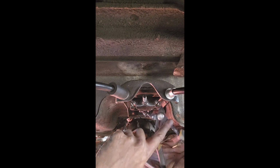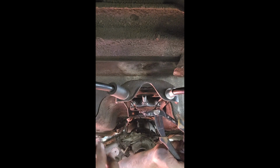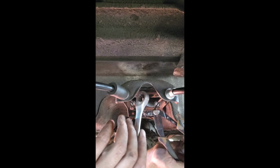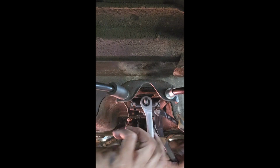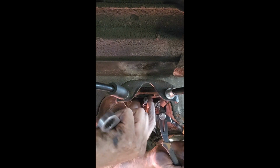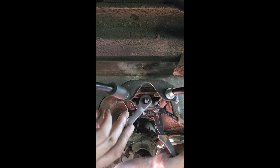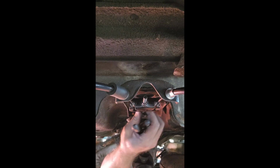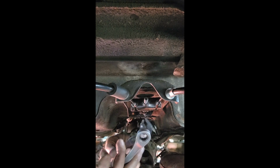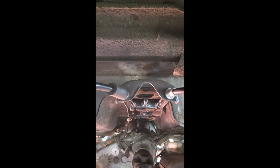Back it off a little bit and just see how well I hold on a hill, so I don't want it to be pushing against. Lefty loosey, righty tighty. I don't want my pads to be rubbing for the first little bit, so we'll keep it loose, and then I'll go for a drive, go sit on a hill, and then pull it. So I know for sure that's not going to be too tight, because we're half decently loose. So all I'll do now is I'll go for a drive, bring my two tools with me, and then I'll adjust it. So I'll show you where I zip tied these things.